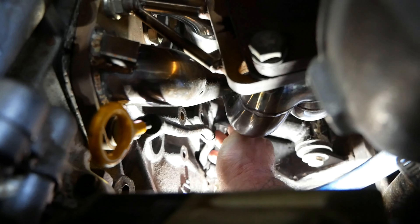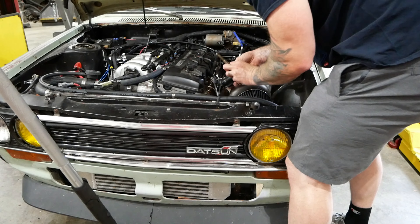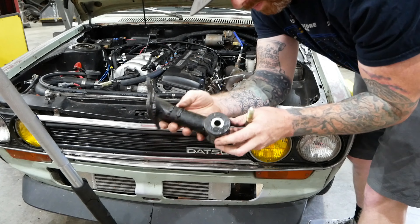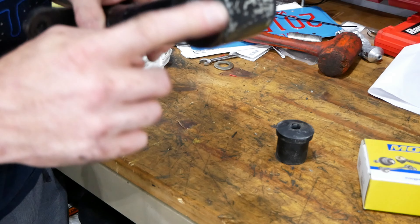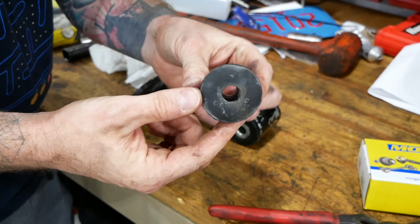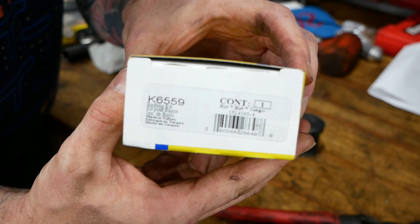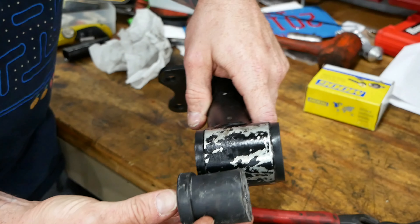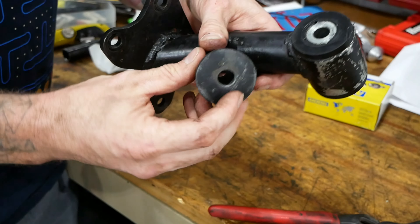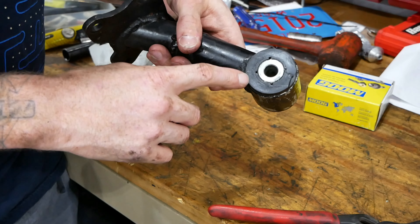There is the motor mount unbolted. I'm going to pop the other bolt right there, and then pull the whole thing out. There's the bolt, and there is my beautiful hideous motor mount. So this is the motor mount that I made — these are polyurethane bushings right here. Here's what I'm going to use instead: this is a rubber leaf spring bushing, part number K6559, a Moog part number. These bushings are not exactly the right size for this — I'm going to have to trim them down lengthwise and open up the center hole just a little bit to allow that sleeve in there. However, this is the closest thing I could find to remove this poly bushing and put a rubber one in its place.